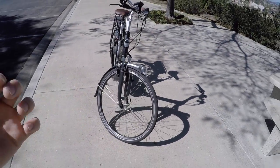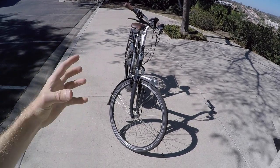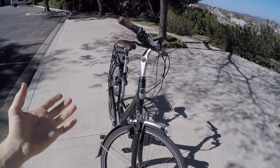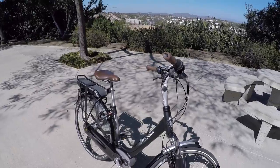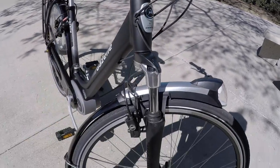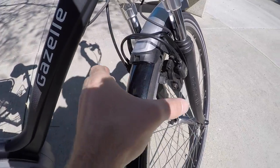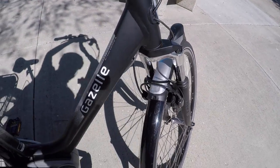But the trade-off with those is the PSI tends to be a little bit higher — they tend to be not quite as forgiving as beach tires or something. It comes back to weight and efficiency. They've really worked their way around the comfort aspects with all that suspension stuff. Also, while I was down here — did you see these brakes? These are linear pull brakes, so they have brake pads just like the old-fashioned ones, but they're hydraulic and they are really strong.